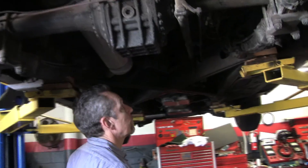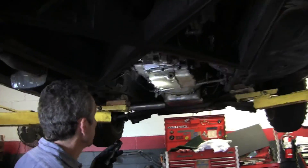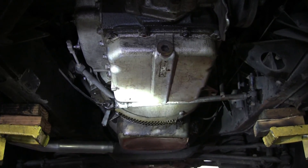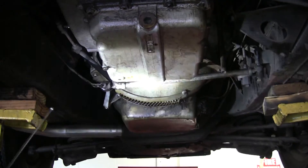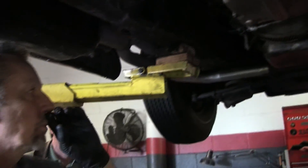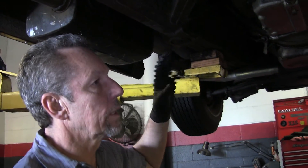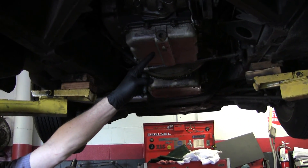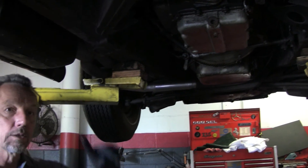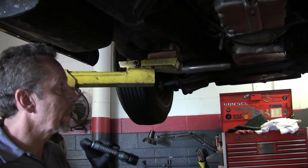Moving up towards the front of the car, we come to the transmission. You might say it's leaking transmission fluid right there — it just dripped in front of us. But if you look at that fluid, it is engine oil, not transmission fluid. That means you've got a leak higher up, coming from the engine. Most inexperienced people lift a car and say it's leaking right there because that's where the fluid is. But like a roof leak, the leak is never where the fluid comes out — it's always way off. That's an important thing to keep in mind.